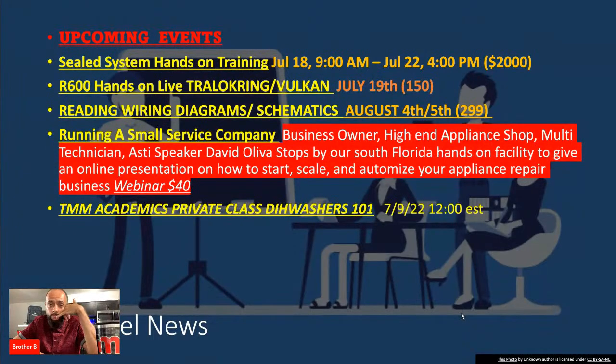I'm at the customer's house, and it's not cooling. Well, what do you mean? Well, I check the evaporator fan. I hear it. I check the condenser fan. I hear it. I put my hand on the compressor, and I feel it. But Brother B, the compressor's hot. It's real hot, man. And then this is me now. Well, brother, did you look at the coils? Did you see if maybe you had a defrost issue? No, Brother B. I only have like a little ball in the corner. I'll send you a picture. What do you think that is? And then I'll get the picture and I'll look and I'll see an incomplete frost pattern on an evaporator coil.